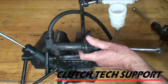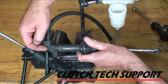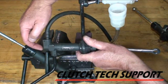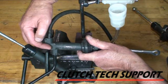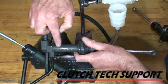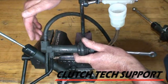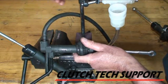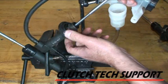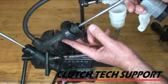Here's another style of master cylinder design. The fluid comes in, goes down to the centerline of the bore, and then takes a right-angle turn to get into the pressure chamber. Because the fluid fills the pressure chamber at the centerline of the bore through a very small hole, you can have an air bubble up there. I would not recommend this type of dry vacuum bleeding for this particular system. And frequently, as in the Rangers, these are mounted at an angle, so the bubble is way up there and this technique just won't pull the bubble out.